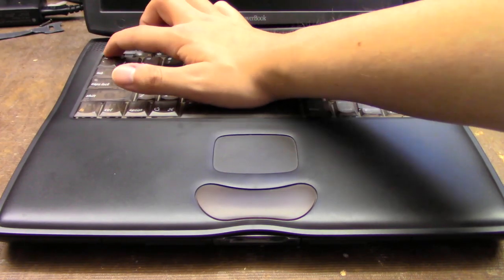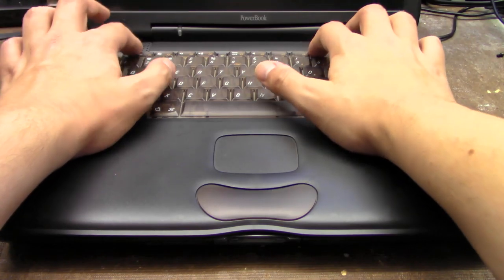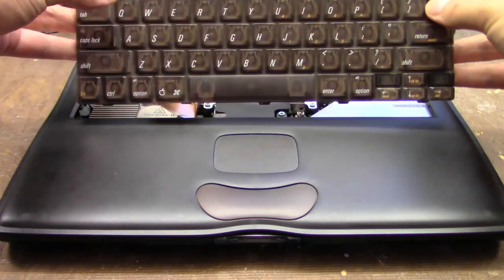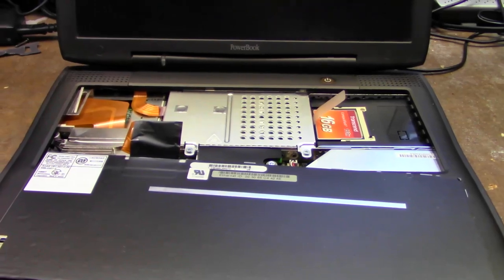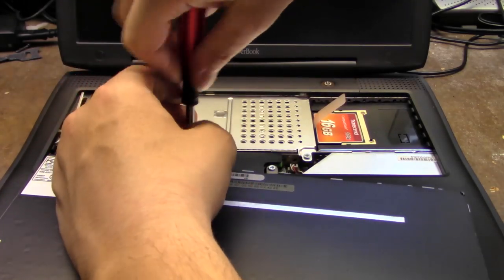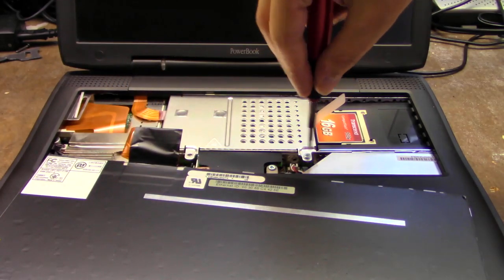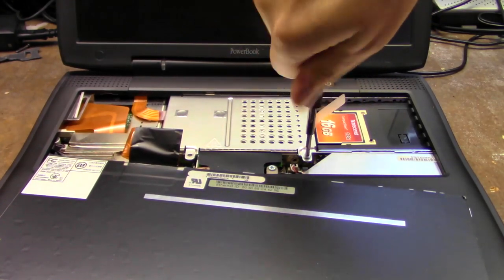And once again, I want to show something that you will never ever see again on a modern day Apple laptop computer. Just pull these tabs away on the keyboard and lift the keyboard out, and you get immediate access to memory expansion, which we saw in our last video regarding this computer, and the screw flew away somewhere inside the laptop. That's really not a good thing.